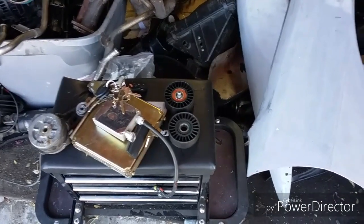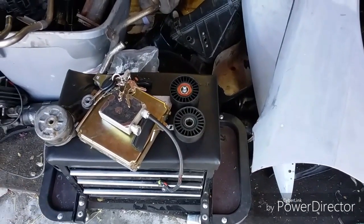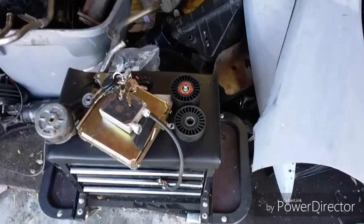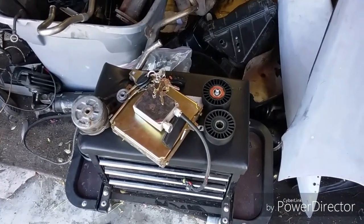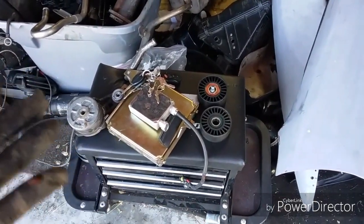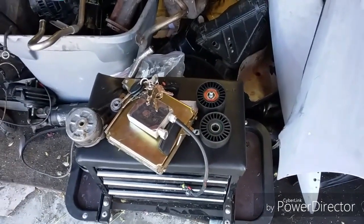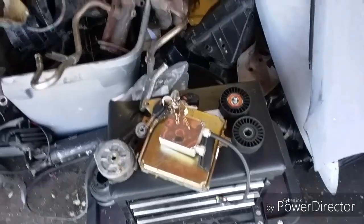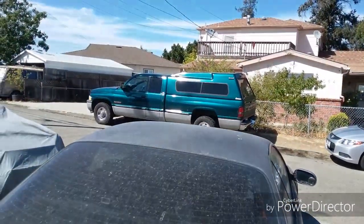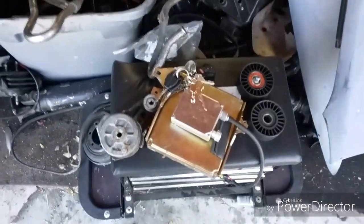It was super simple to diagnose. You have the car or truck running and you squeeze a little bit of water onto the pulley — if the squeaking goes away, it's the belt and you need to tighten it up. If the squeaking doesn't go away, it's a pulley. Also, look at the belt and see if it's wobbling back and forth along the serpentine belt. I'm going to reinstall this — I'll try to film it one-handed, which is kind of hard because this is a big truck. The tensioner was way tighter than I expected.